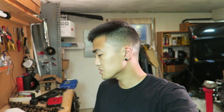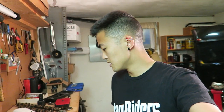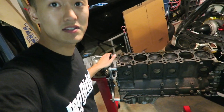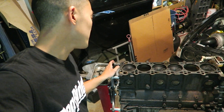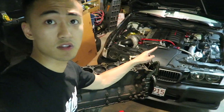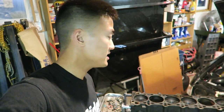I highly recommend making sure you've got the proper set of tools — the VANOS tool set, all necessary head bolt tools, hardware, and a bunch of long socket torx bits. The next step is to take apart the block, which is very dirty with a lot of carbon deposit, but the state of this motor is much better than the one currently in the car. I hope you guys enjoyed this DIY — don't forget to hit subscribe and I'll catch you in the next video.